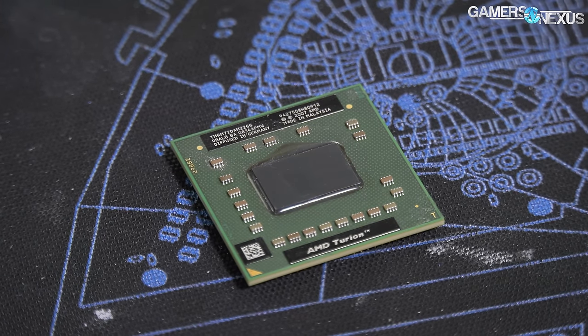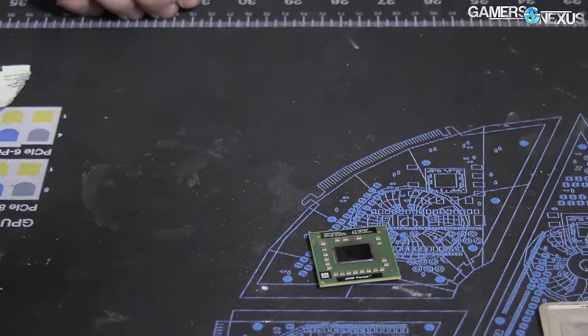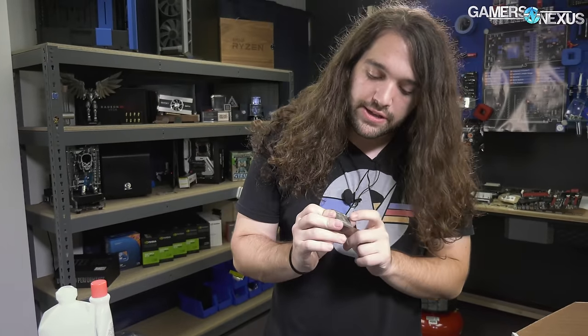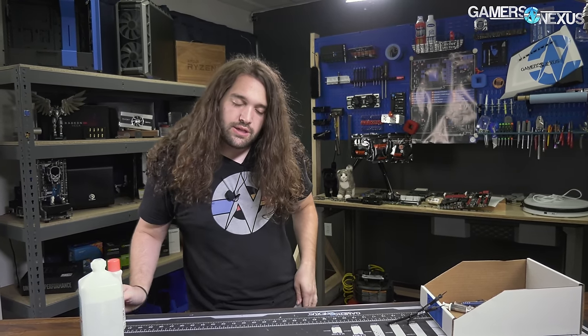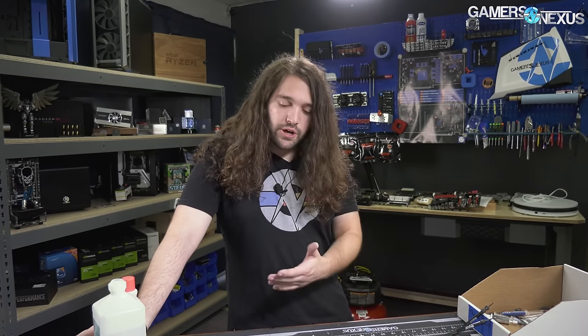That's how you clean them. If you've been wondering how to clean liquid metal off a component once you're done working on it, that's how you do it. Cleaning the IHSs is probably the biggest question people have had, and the answer is: you can get a lot of it off, but not all of it. The rest stains, and if you're neurotic about cleaning it, just try not to be — using steel wool will sand down the surface, and while it'll get the liquid metal stain off, it'll also remove the metal itself, leaving you with worse performance because it's no longer smooth. As long as you touch the stain and it's smooth, leave it alone. Reapply your liquid metal and you'll be fine. Copper will stain naturally because of ion migration from the gallium compound into the copper — that's fine. If it needs more liquid metal, just apply more. It's effectively plated, so it's not causing damage or corrosion, though you might see some pitting depending on the exact solution you're using.